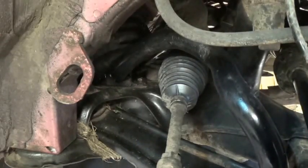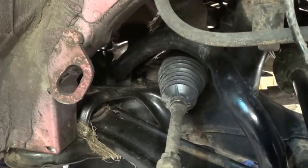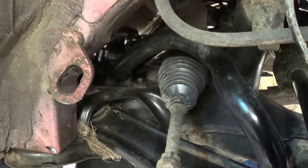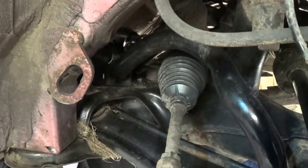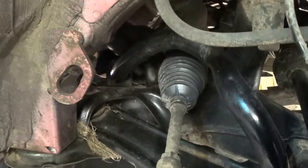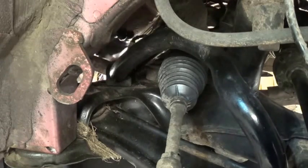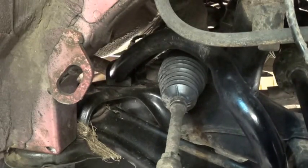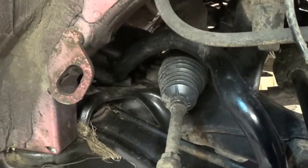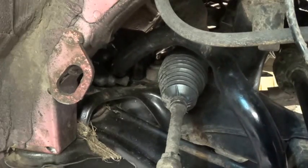That's the passenger side loosened off then. So I'm going to go ahead and take these ones right out. That's the bolts out. Should now be just a case of lifting the bracket away. There it is. Just look at the orientation. Yeah, that looks like it'll go back either way around, so that's okay. The bar should be free now, noting that the split in the rubber is at the front, and I should be able to just pull that out.